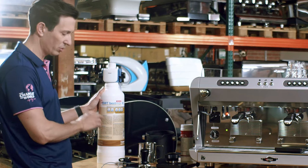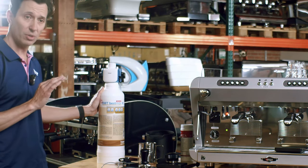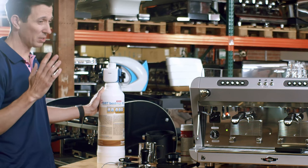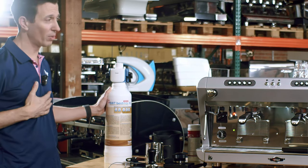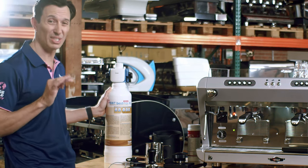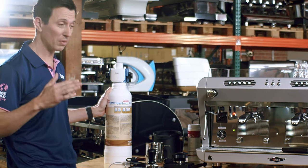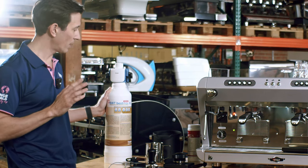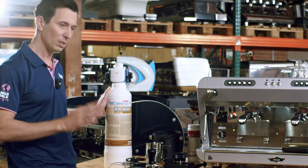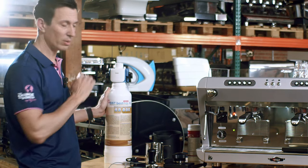This system runs around five to six hundred dollars with all the accessories. It's great for most areas, but if you're in an area with 20 grains of hardness — like in the desert or really hard water areas — I'm always going to recommend reverse osmosis. Reverse osmosis is more expensive, starting at two grand and going up to three and a half grand, so it can be a different kettle of fish. But these BWT systems work really well with single copper boiler machines, which is why we sell a lot of them.